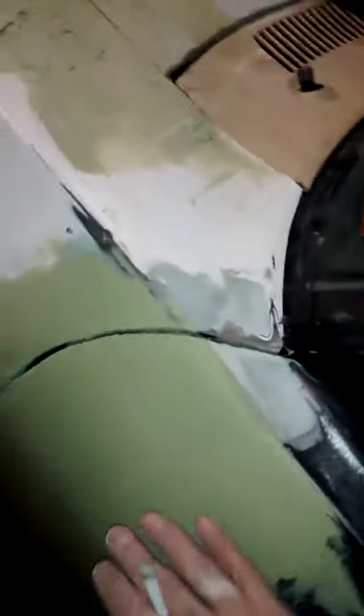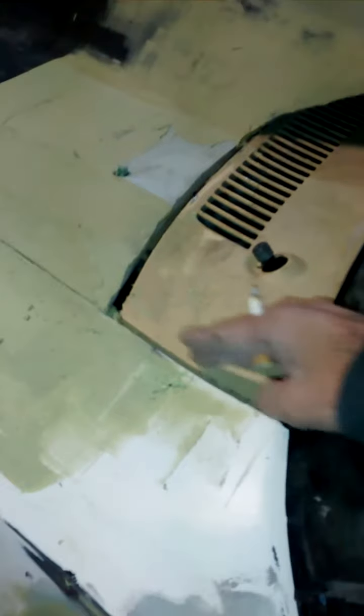The fenders are bolted in — I did these as well, made my lines. They're just rough right now because the mud behind there needs to be cut out, but I'm going to have a quarter-inch gap around everything. The hood is going to be about the same — a little bit tighter — as I want a clean-looking result. Then I'll tighten these gaps up here for the cowl later so they're all uniform.